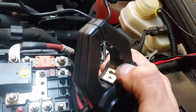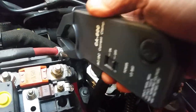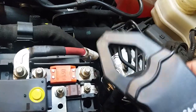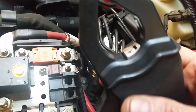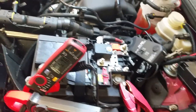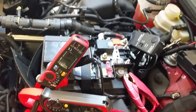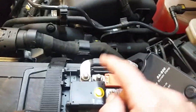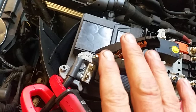These clamps have a polarity — you can see the arrow on it marked plus, it goes that way. When you put it on the starter motor cable — which is handy because the two cables are separate, this one goes straight to the starter motor — you put it on with the plus facing away from you. Now, this arrow indicates conventional current flow, which is actually incorrect. It's one of the first things I learned in electrical theory — conventional current flow is wrong.